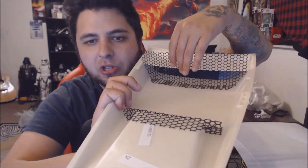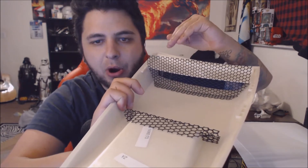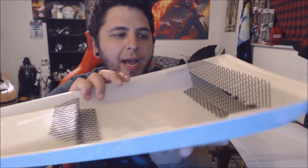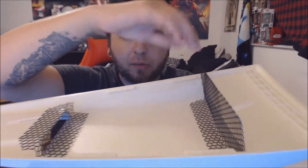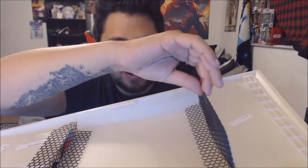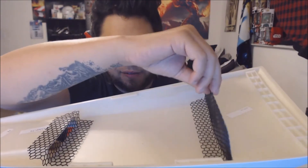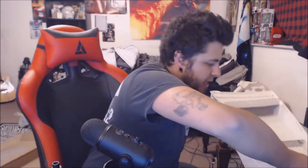It's not going to fit all the way every time because you'll still have excess on one side. Keep pulling it out — use scissors, not tin snips — and just keep cutting off a little bit at a time until it fits flush against the back with no gaps. Then fold that top part down and use the 3M adhesive. Just fold one end down, stick it in there, and keep cutting off the sides until it fills the gap perfectly for your Eleanor scoop from MMD.